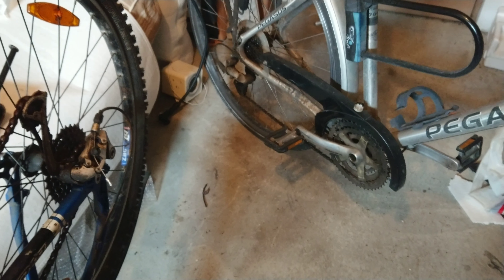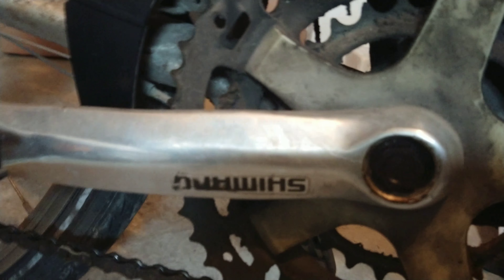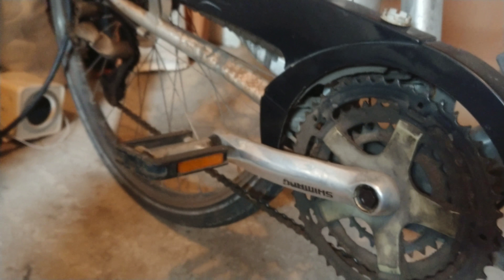So here's a small forward: I was not aware that we have quite a lot of different bottom bracket systems around these days. I'll show you how to exchange a bottom bracket of this type, which is probably a square taper bottom bracket - the most classical older style, which you will have on most older and cheaper bicycles. Over here we have octalink, which is basically about the same thing, but instead of a square taper you have an octagonal shape with several spokes, giving you a bit of a bigger area.